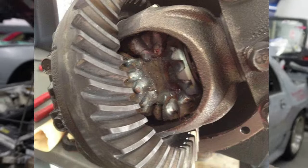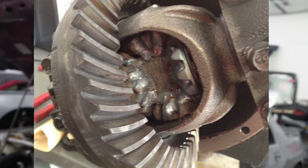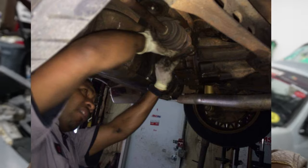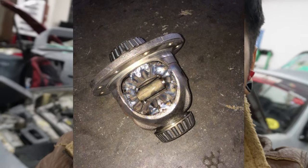The next thing you can do to make your RX-7 easier to drift is weld your diff. Don't even start with a VLSD — although there are people who can weld a VLSD if that's all you have. Get yourself an open diff and get somebody to weld it. I remember when I started drifting I stuck with just the VLSD and learned everything the hard way. Just start with a welded diff — that's the standard right now. If you don't have a welded diff, you're gonna slow your progression and waste tires.